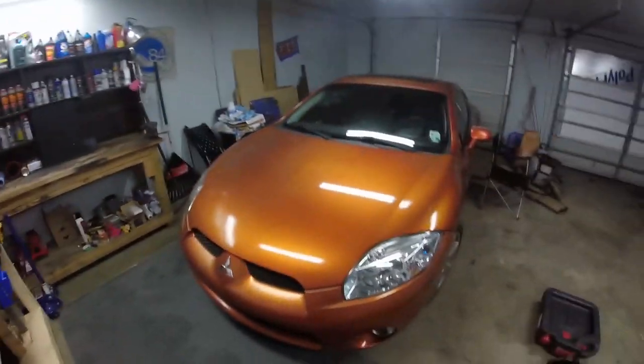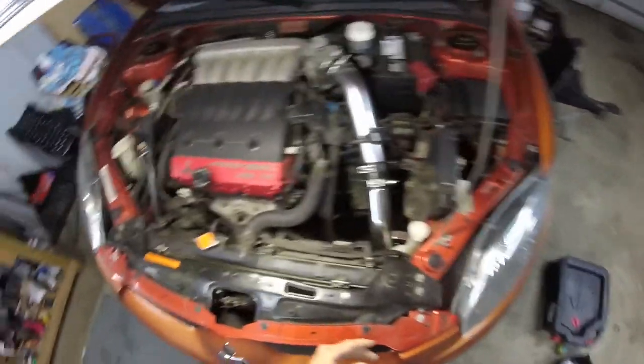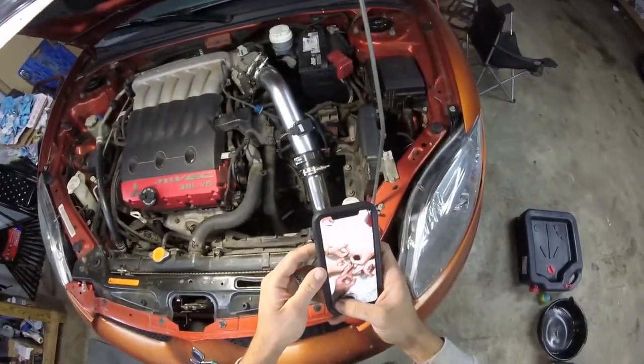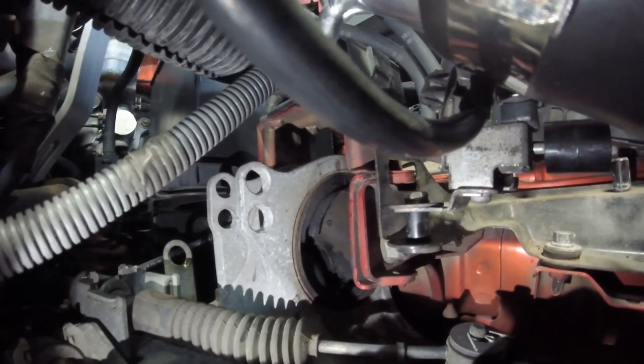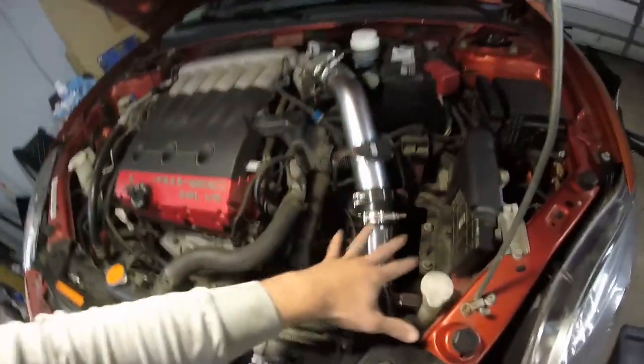Update: it's actually not a broken motor mount, it's a broken transmission mount. I don't know how well you can see this, but it's completely blown. Every time I shift, you feel the car pick up and set back down. We'll order another one and have to put that in before we put the transmission back in.